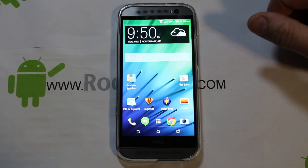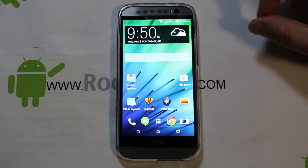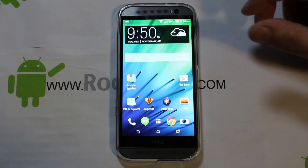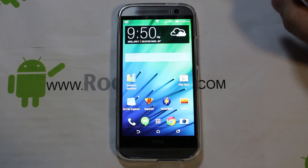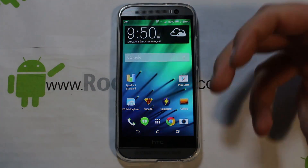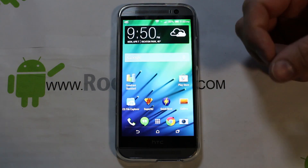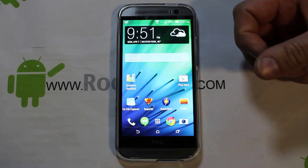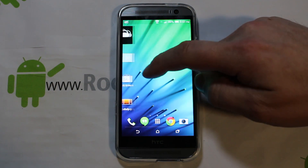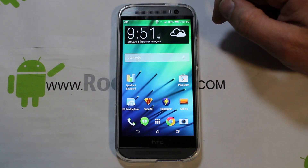Here's another fun video on the HTC One M8 Verizon variant. Today I'm going to show you how to install insecure boot, or insecure kernel. The reason you're doing this is you do have root access — once you've got recovery, flashed SuperSU, and all that, you should have full root access — but there's still a quasi write-protect blocking certain things on your system. Installing this insecure boot file will alleviate that and you'll actually be able to write to everything without any issues.